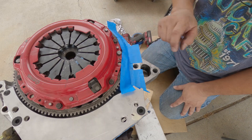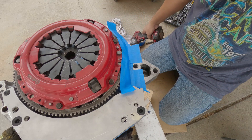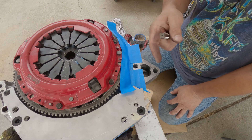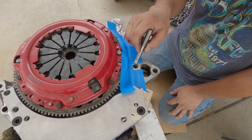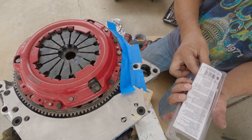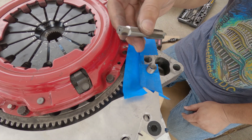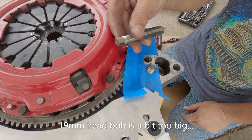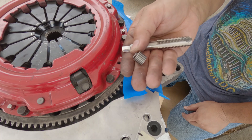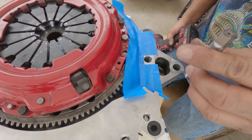I've decided to put the helicoil on this side and just use a long bolt. For those wondering why I didn't use a metric insert or helicoil — it's because of this: one-half by thirteen, it's perfectly sized. That's the reason. I have a bunch of these inserts. If I use metric I'd have to use a larger bolt — I think 19 millimeter. Mainly I chose standard because I have a bunch of these at home, so I'm putting them to use. You can use metric if you want.